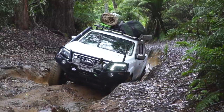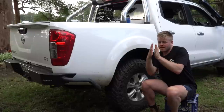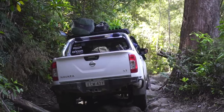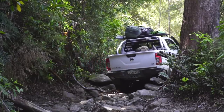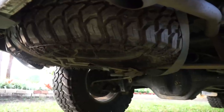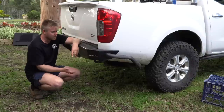In the rear I have taken out the sway bar, so there's a lot more suspension travel — it helps big time off-road. I've also added an adjustable panhard rod because once you lift it, the whole rear diff shifted about 10mm to the passenger side. The adjustable panhard rod allowed us to re-centre everything nicely. That's not 100% necessary on a two-inch lift — you can get away with that little imbalance — but you would need one for a three or four-inch lift. The 285/75 spare tire still fits in the original under-tray spot; I let it down to about 5 psi, compress it in with a ratchet strap and it fits up in there.